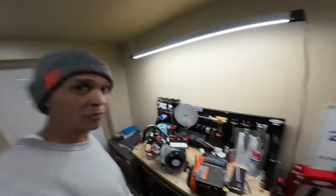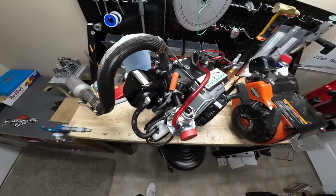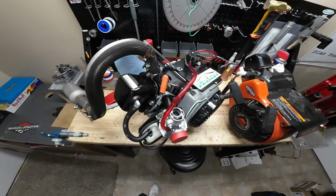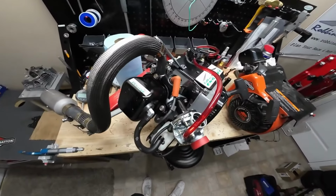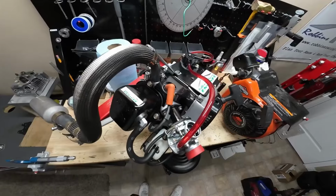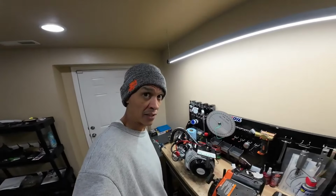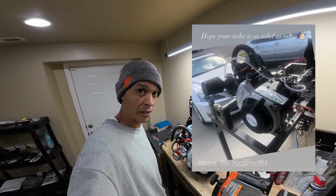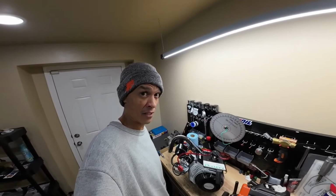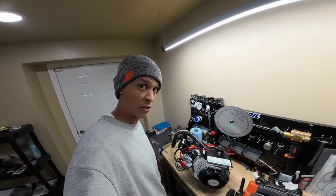Kind of an unfortunate consequence, but my head is all sealed up. I pulled it off, cut the exhaust valve, lapped it up, got 2 days before this race, and I just didn't feel comfortable sending this thing out with the thought in the back of my head that this engine might be down on power. It just wasn't sitting well. So I went ahead and did that service. Sorry I didn't have time to film it. I had to scramble to get it done. But one thing I didn't mention when I was doing the data review is that the short block that I built, when I had it on the dyno, pulled substantially more horsepower than my engine, and that's what led me to believe I may have an issue with my engine. So I'm glad I got that fixed up, so we should be good to go this weekend.